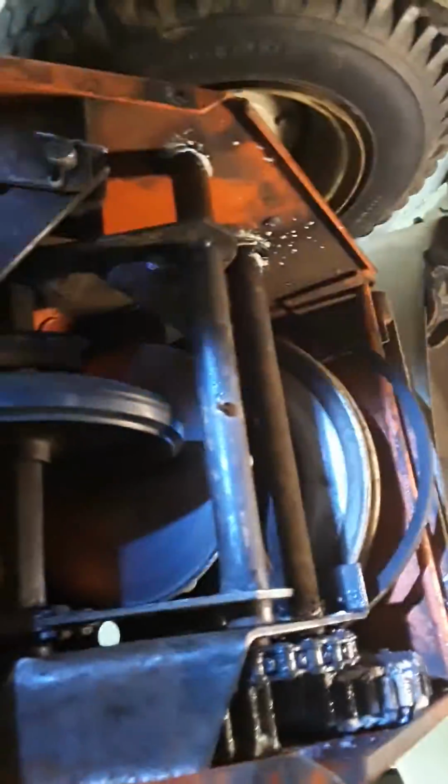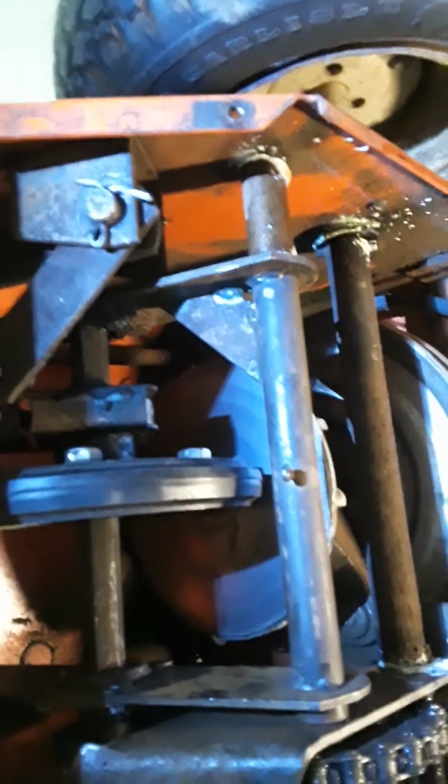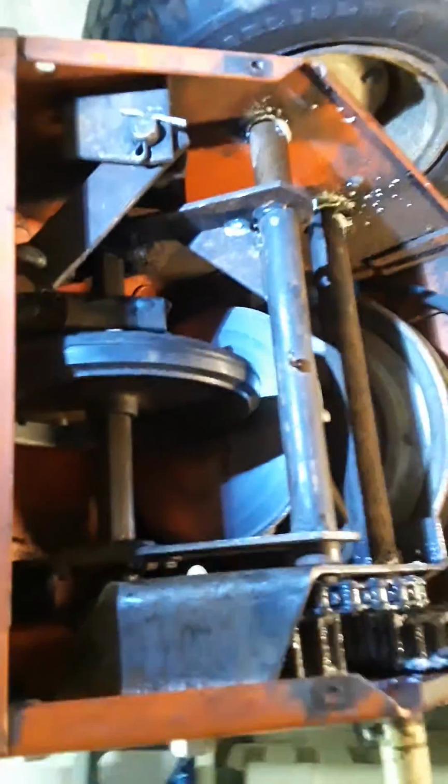Once you do that, and you have the whole hub out, you remove the 5 bolts holding the old friction disc to this piece of cast iron in there, okay? Once they're off, you work the old friction disc up off of this piece. Then you put the new friction disc on, and do everything in reverse, alright? You put the whole friction assembly back up in there on the thing it hangs on.